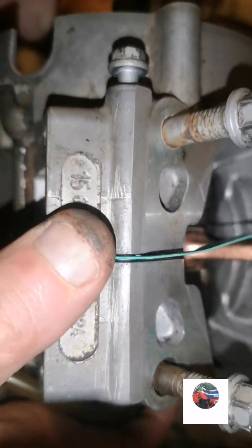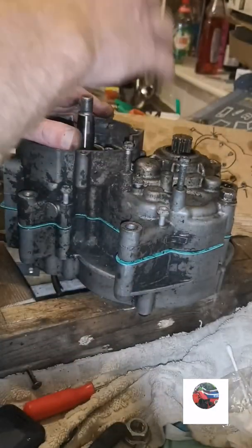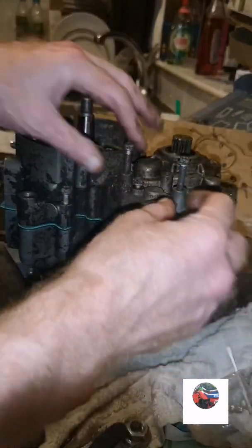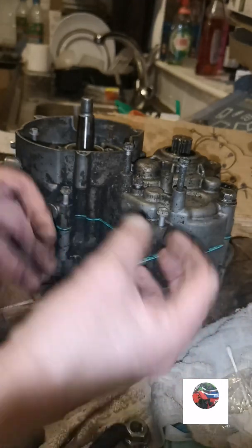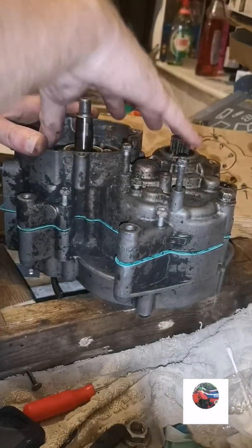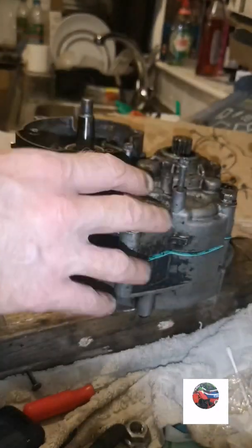And there, lift that one. So now when you get like that, you need a rubber mallet it. I'll get the crank puller on again and push that casing down. Don't tighten these screws up to nip the case together. Leave a rubber mallet it. Get the crank pusher on, push it down. Then we'll tighten all these screws up.